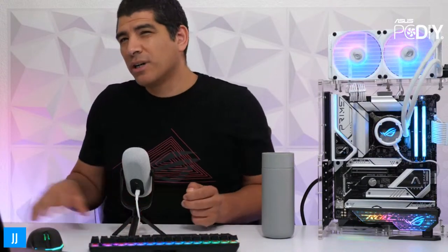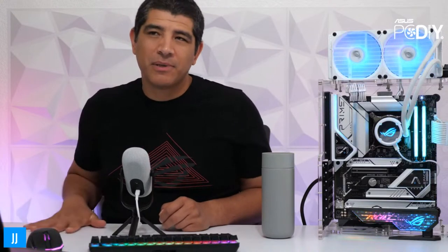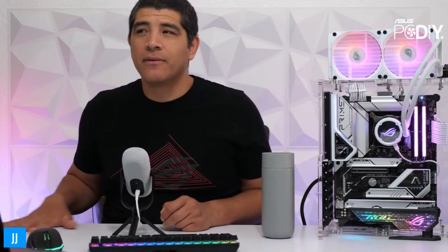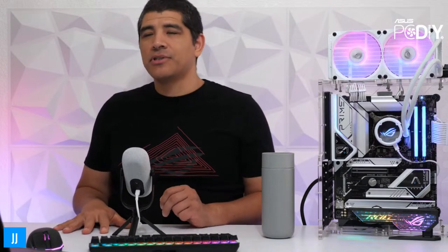Marcus asks, why does ASUS not make monitors with VA panels? We do. We actually have lots of monitors with VA panels. You can take a look at our website. We probably have at least something like 15 monitors with VA panels. VA is traditionally more common for curved displays. When you talk about flatter displays, the specifications are usually going to be more of a benefit with the latest generation of IPS or IPS-like displays having a benefit over VA. VA does have a benefit in contrast, but right now most VA-based solutions are going to be curved displays. So a lot of our curved monitors are going to be VA panels, okay?